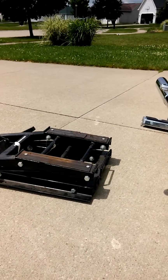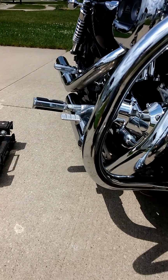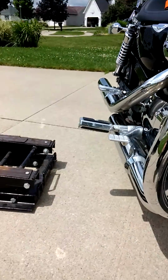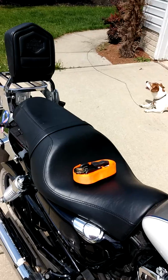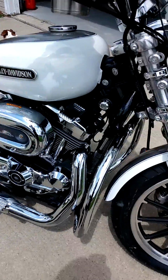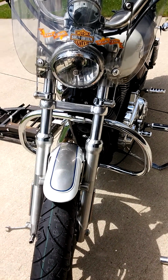After you get the tire off, I would put the jack all the way back down again. Leave it under the bike, but put the jack all the way at the bottom position, because I've actually had the bike tip over on the jack. It's not the most stable thing. Once you have it down all the way to the bottom, I would take a ratchet strap and hold the bike in place. You can hook the ratchet straps to the little knobby things all around there that hold it up. And you would also want to keep the kickstand down, just in case the bike comes off the jack. At least it'll land on the kickstand and won't tip the whole bike over.